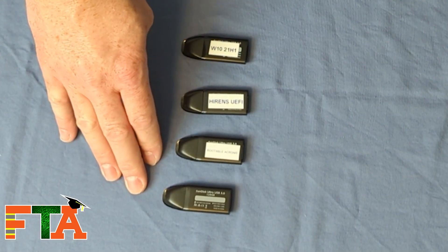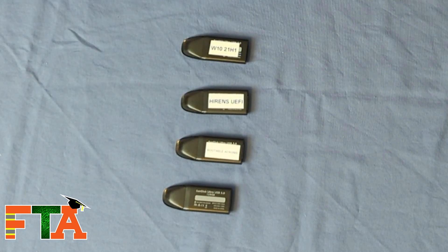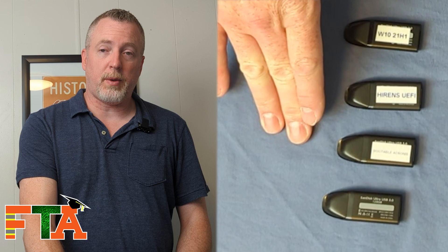I've had trouble using off-brand thumb drives, so SanDisk drives are what I always keep — that way I know they are compatible and readable by all equipment. I always keep one blank thumb drive for data transfer, and this one is 128 gigs because I want more space. If you find yourself running into larger data transfers than 128 gigs you're probably going to want an external drive. If you need to clone a customer's drive out in the field you need good quality cloning software. I found that free programs sometimes don't work as well as a paid program, so I bought Acronis' cloning tool — they allow you to make a bootable thumb drive so you can slave up a drive and clone one drive to another right there in the field.